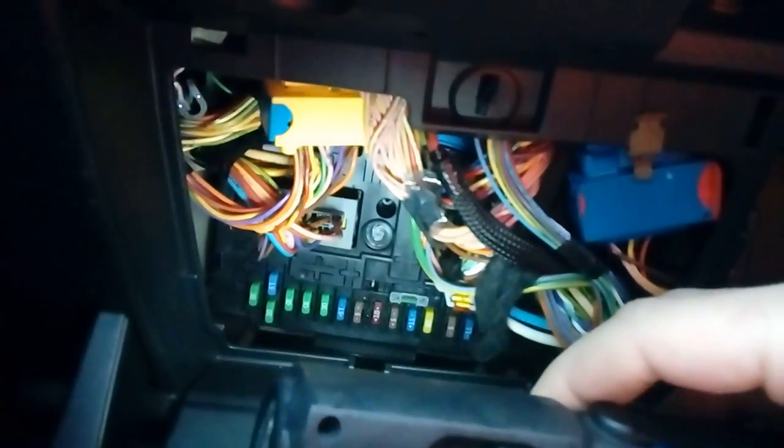You're going to need access to your fuse box, which is in your glove box. Drop your glove box door down — it's behind here. There's a twist thing to turn, very easy. Turn that and pull the flap off. The fuses are buried down below — I'll get the torch on that so you can see better. There's your fuses at the bottom.